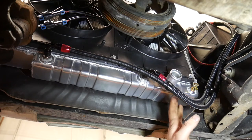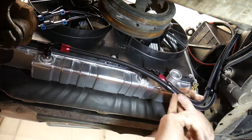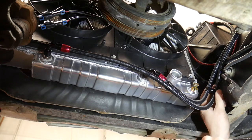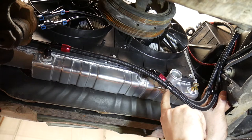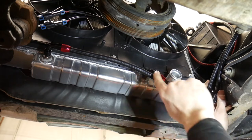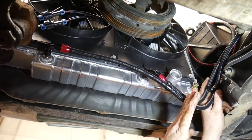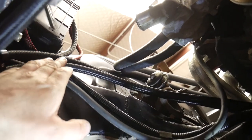To save time on camera, I fabricated these two ends with a 90 and a 90. I also got these little clamps from Amazon to hold the hose - they were pretty cheap, got four of them but might need a few more. I'm going to drop it below the radiator hose over to the frame rail, kind of out of the way, then head behind the engine mount and along the side of the block. I'll finish routing after I get the other ends on.